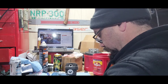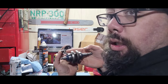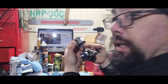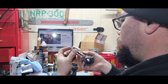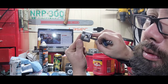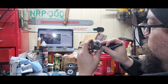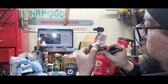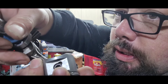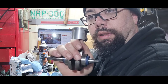I usually like to oil up the wrist pins before I put them in, but sometimes they go in not bad. This one is up to that stage so far. The fun part is now getting it all lined up with the bearing. If it shows up at all, you can get an idea looking through your piston. Sometimes you can just go and it lines up perfectly and it just pushes right through — there we go, like this one. I already have a circlip on that side — that's where it's going to bottom out. That's now in.